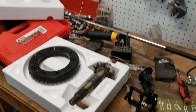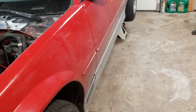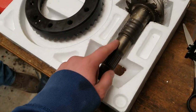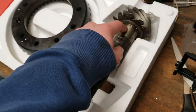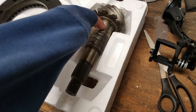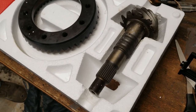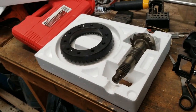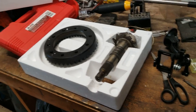We're going to have to do something fancy with the bearing because we don't have a press. The outer bearing should just be able to tap out since it's a looser fit. The head bearing is press fit onto the shaft, and I don't think we're going to get the old head bearing off in one piece — actually I know we're not. We probably won't even try.